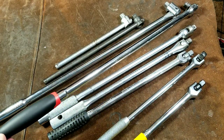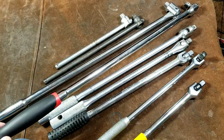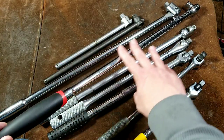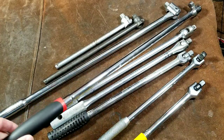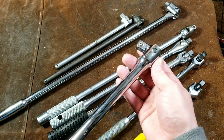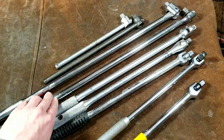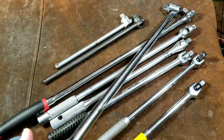Many fasteners have fallen to half-inch drive breaker bars, but I've found that once you start getting fasteners into a few hundred pounds, you notice the springiness — especially on the Harbor Freight long handle. Fasteners you probably should be using three-quarter inch drive for. These breaker bars will pretty much take care of almost all automotive and light truck needs, but once you get into heavier trucks, diesels, heavy equipment — half-inch drive becomes the new quarter-inch, essentially, unless you're doing interior work.